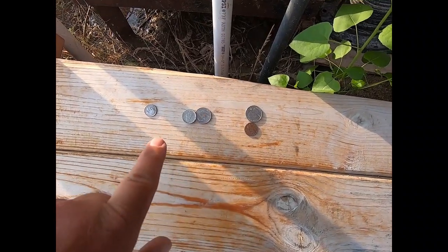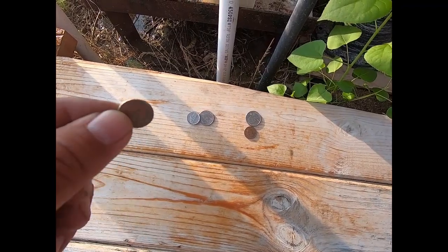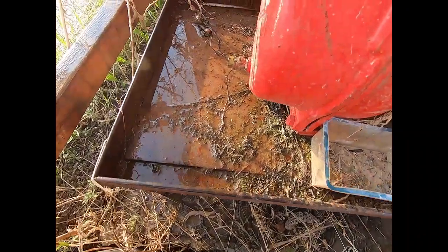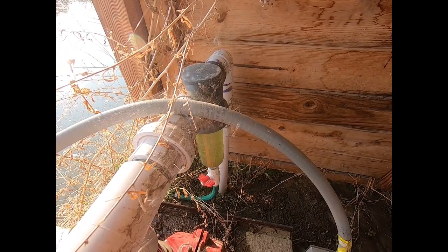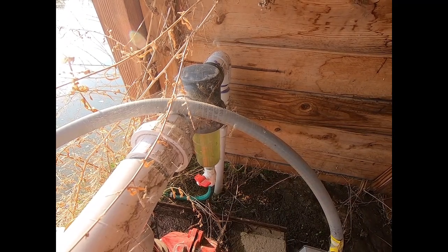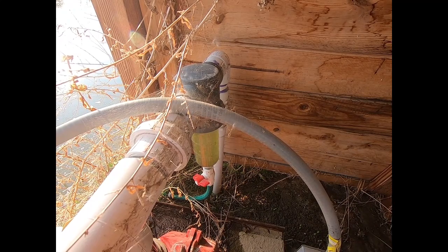What's with the dime here? Well, Henry Ford used to always say you could adjust the points on his Model T Ford using one thin dime — also works on that little valve when you don't have a screwdriver. If you can hear that hissing going on when you're priming one of these pumps, that's air getting around all the systems. We've got to wait for that to quit before we turn the pump on.